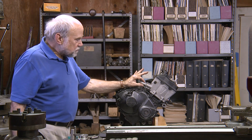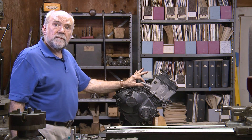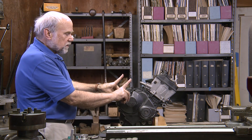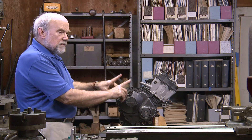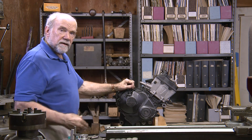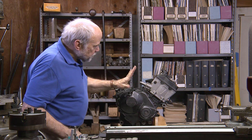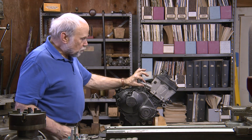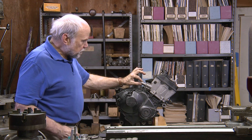This device is only seen on engines with overhead cams that are driven by chain. The chain has to have, as we saw earlier, plastic dampers that prevent the free runs of the chain from vibrating and destroying themselves. This presses the shoe against the chain. This is a hydraulically operated one; some are operated by springs.